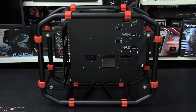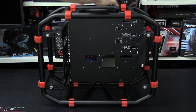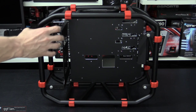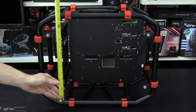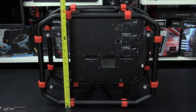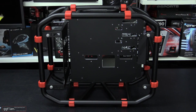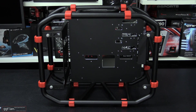Looking at the dimensions: this is ITX only, though some people have modded an M-ATX board in by simply moving it over — there's no IO shield and no dedicated fixed motherboard position, so it's possible. But straight from the manufacturer it supports ITX only. The height is roughly 400mm, the length is 500mm, and the depth is about 240mm, making it relatively small for what it offers.